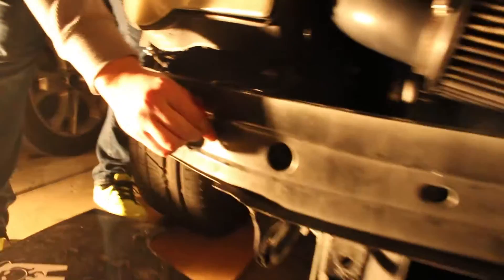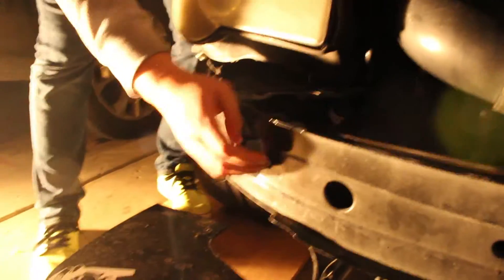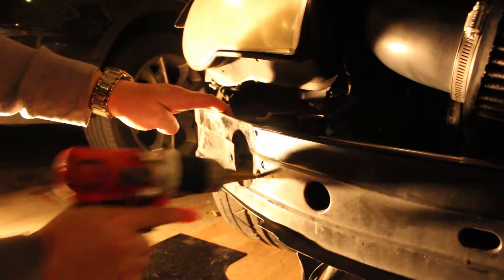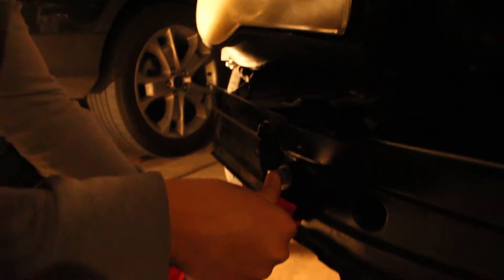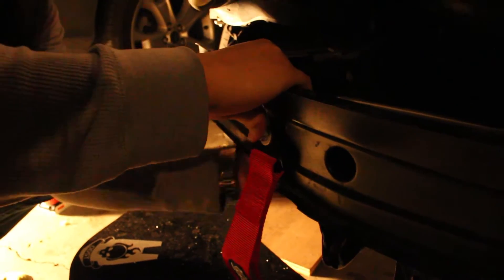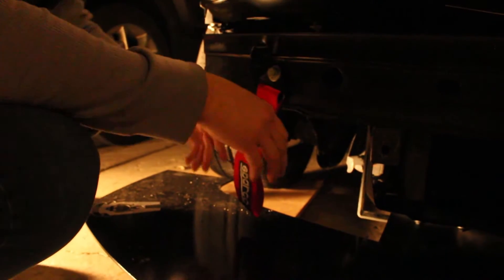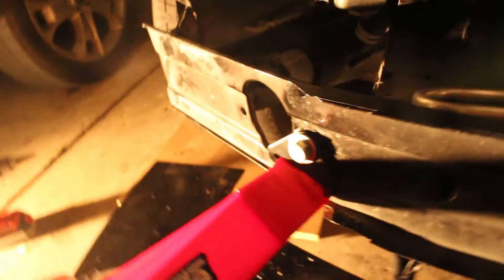This is the hole we are going into. Since it is a little bit thinner on the crash bar right here, we are going to put that metal piece that we are cutting up — that is what we are doing that for. Let's extend this hole and get it in there. I thought that was a spider; I saw that leaf coming and I was like, what is it? That is legit. Alright, so we are going to tighten this down, do some measuring to see where we got to cut on the bumper, and then this will be done. Look at that — it is bolted in. Yank on it, Jake, so they can see. Jake is putting all his body weight pulling it. It is on there very well.